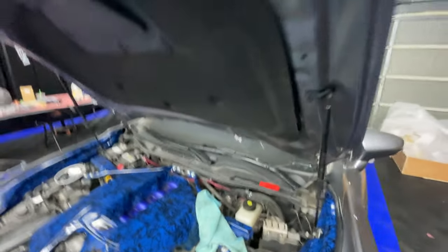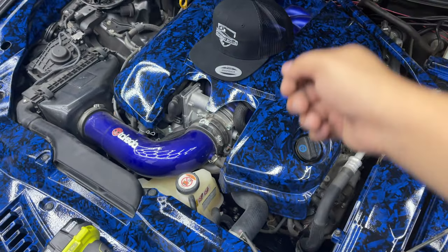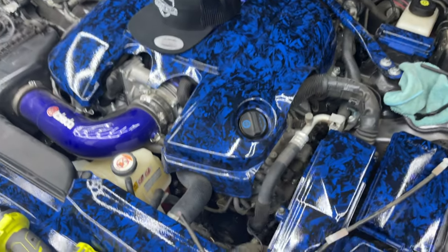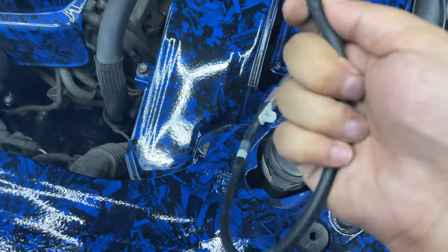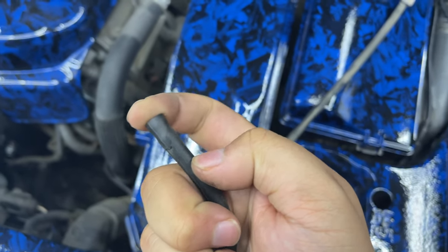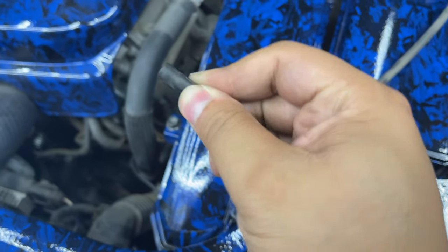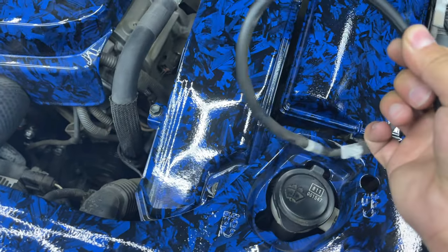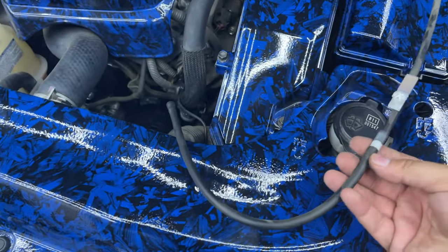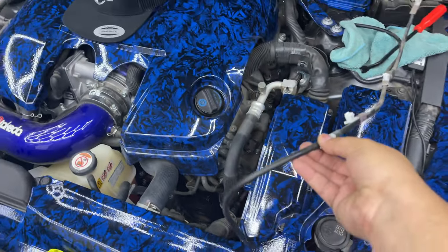So I'm gonna go ahead and do that off camera real quick. Make sure you guys are careful when you put the flathead screwdriver in to take off the little spray thing for the windshield washer fluid. I stuck it in a little bit too far and kind of cut this one right here, but it's fine. I can cut it from right here where it's torn and just connect it. There's a little bit of slack, but if there's not enough slack for you to do that, you can just disconnect it from here and buy a new line from AutoZone. They sell these everywhere, AutoZone, Home Depot.